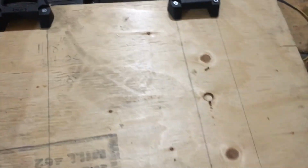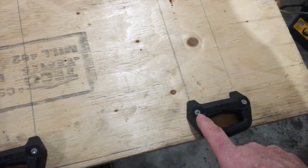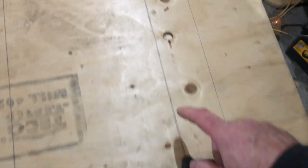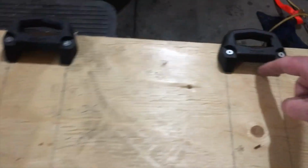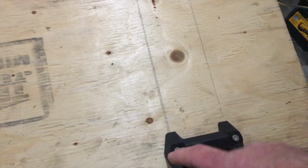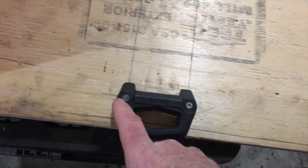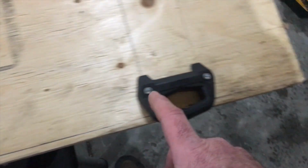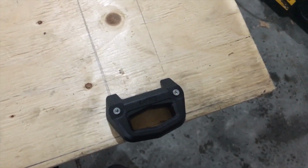The brackets end up being 14 1/4 inches apart, the holes from center to center, but across them is 15 1/4 inches on center from here to here. A good point to note is 14 1/4 from opening to opening, and 15 1/4 from the center of the bolts. From this bolt to this bolt, it's 10 3/4 inches, and likewise, this bolt to the back bolt is 10 3/4 inches. I'll post it all in the description below so you can see it.